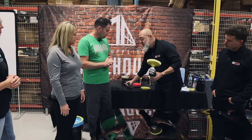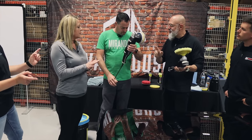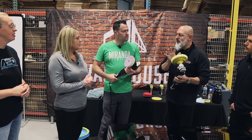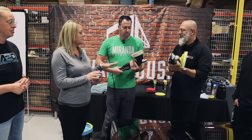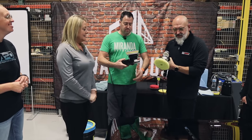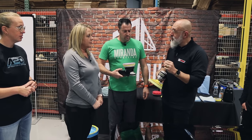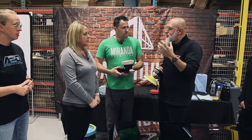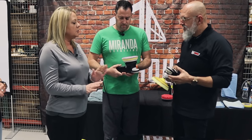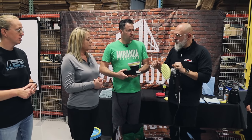Which polisher should Amy pick up first? I like to use two different polishers — a dual action machine for cutting and I finish with a rotary, which is a little backwards for most. Cutting is when we have deeper defects we want to remove. Polishing is when we want to bring up the highest gloss possible, make it look shiny. We're finishing with the rotary and cutting with the dual action.